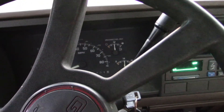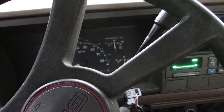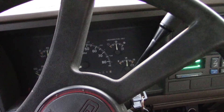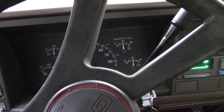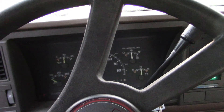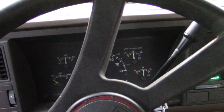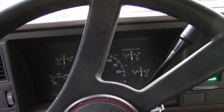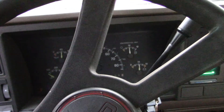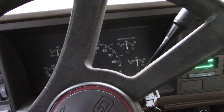All you have to do is disconnect the negative post on the battery for about 30 seconds. What I did was, before I started changing out the sensor, I just unhooked the battery and when I was done I plugged it back in. It runs a ton better — that was the problem the whole time. The top was actually broken off of the sensor and whoever had the truck before me decided to zip-tie it down. The whole top was broke off, so I don't even think the switch was bad — it probably just wasn't making a good connection. Anyway guys, appreciate it — give me just a second and I'll get that code list up. Thanks guys, see you on the next one.